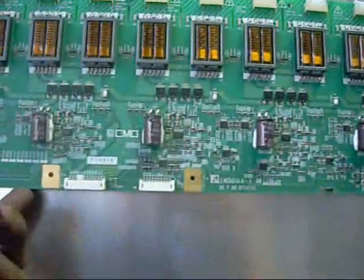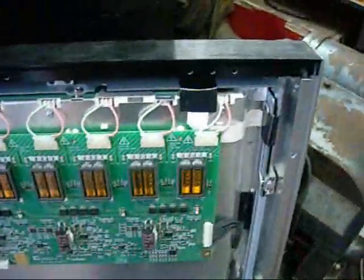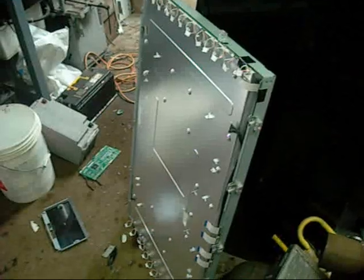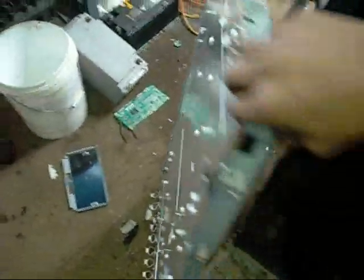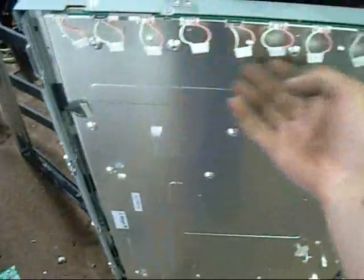And these are the driver boards. All high voltage outputs. Cold cathode lamps or something. A bit different to the other LCDs that I've seen, like laptop screens usually just have one at the top, or maybe one at the top and one at the bottom, and that's about it. But these ones here, it's heaps. I don't know what's going on here. Same with the bottom. Okay, well that's the bare panel. Time to take out 500,000 screws and try and take it apart. All that backlighting obviously. Got all those different connectors.